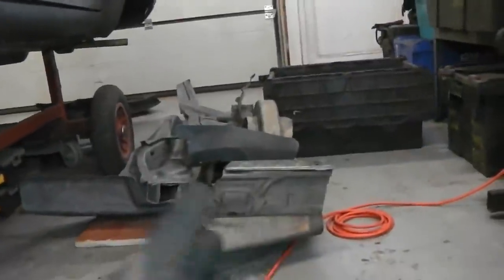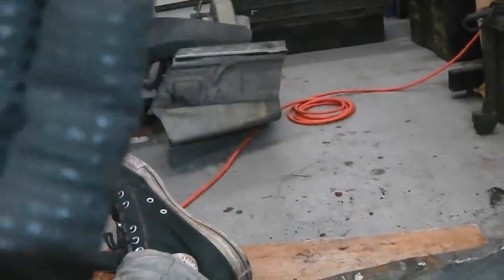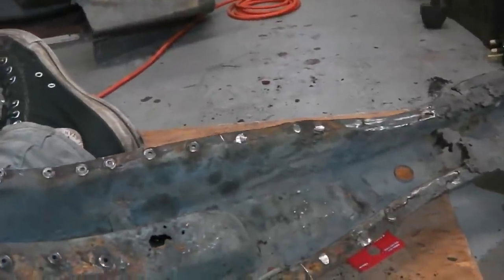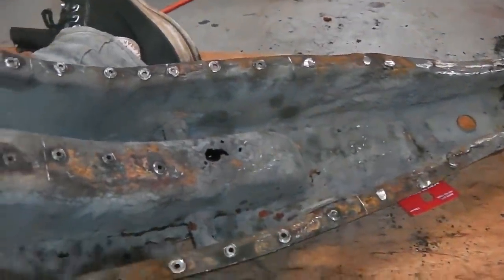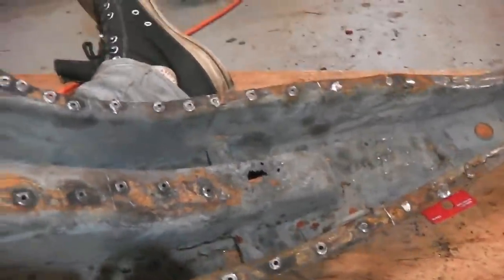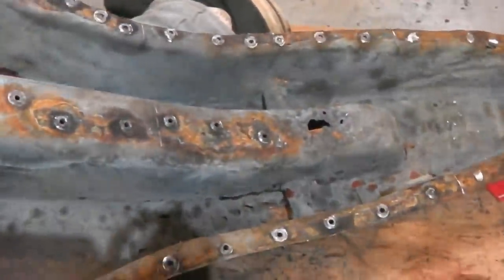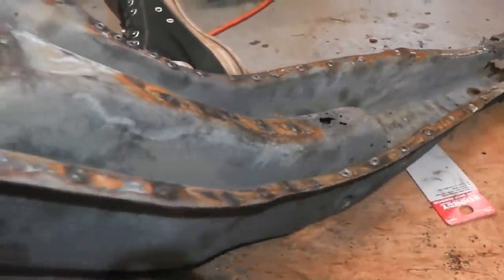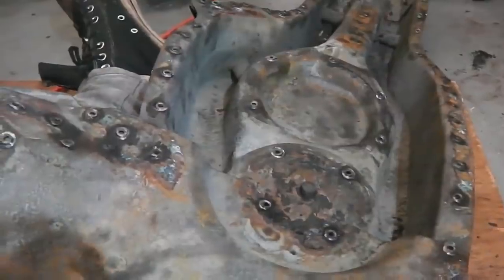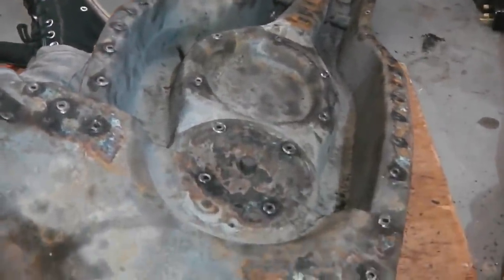Now it's going to have a slice line through it, so we're going to have lost some length. We'll have to make that up by putting fillet pieces in and bringing it back, then infilling. So the welder will take up where the angle grinder sliced through the metal, the end result being that you'll have this exactly the right length, but with a splice in there and a splice there. Well, that would give us what we're not going to be able to get otherwise, so it gets us out of trouble. We'll shot blast this once it's finished, so that it's clean, and then we'll prime it up and we can get it painted.